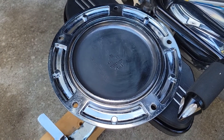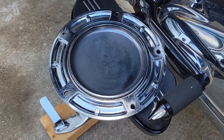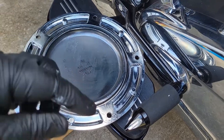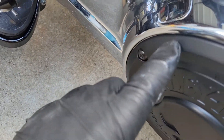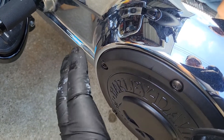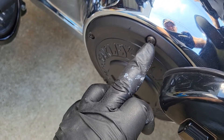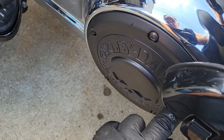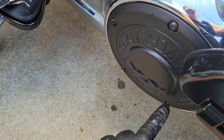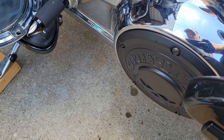I went ahead and replaced my derby cover — or the clutch inspection cover, whichever you want to call it. I gently pulled the gasket out, worked my way around so I didn't stretch it, and then put it in the groove of the new one. Make sure you clean the surface and then put it back on. You want to tighten these in a star pattern — say two o'clock, then seven o'clock, then noon, and so forth — and tighten to the torque specifications in your manual.